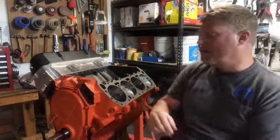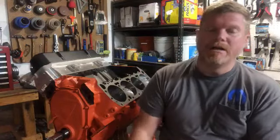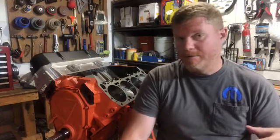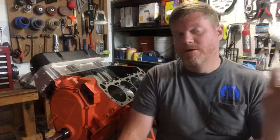Okay. So anyway, guys are asking, can I run ethanol gas? Yes. Why? Better materials. You can run 10%, 15% ethanol gas, pump gas, you'll be fine. Your four-stroke was built with superior materials. It's not going to eat up, you know, it's not a big block Oldsmobile. You'll be fine. It's not going to eat up your rings. It's not going to eat up your valves.